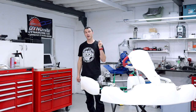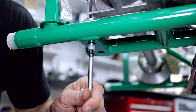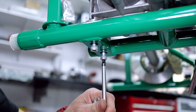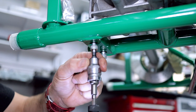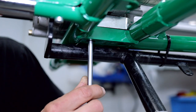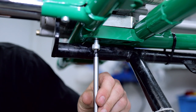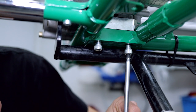Now you just need to install the four M8 cap screws up through the chassis and into the engine. Get the M8 bolt started with the allen key just like so, give it a little jiggle, and then you can nip them up with the rattle gun. To line the hole up you can just stick the allen key up without the bolt and give it a little jiggle in the threaded hole, then get your M8 cap screw and get each one started.